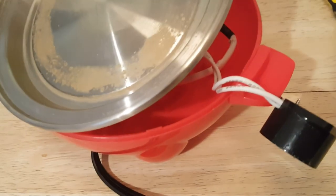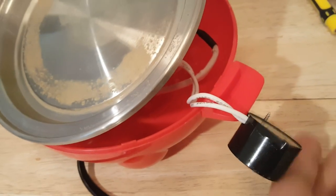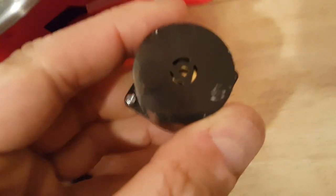I've already got it partially disassembled. This is the buzzer that's making all the noise. I've disassembled it somewhat — it's held in place with two screws. I'll show you again when I put it back together. You don't need to disassemble it more than that: one nut underneath, and then the buzzer itself is held in with two very small Phillips head screws.